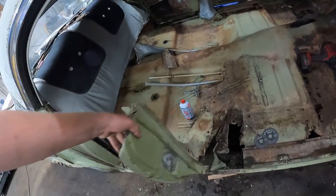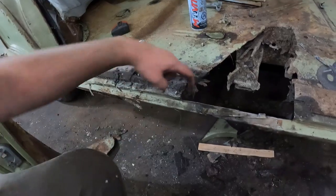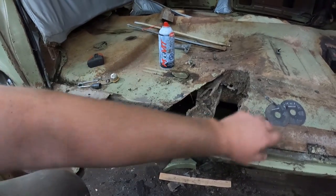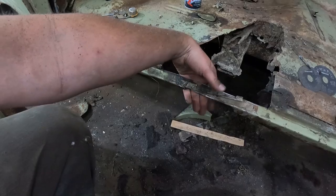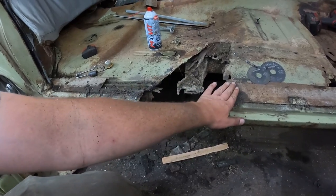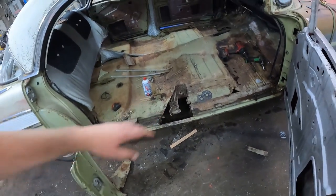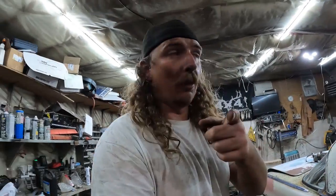This is a pretty hefty piece of goods. What I'm thinking: I'm going to run some of that thick steel under and weld that, then I'm going to get just some thin — I think I got 18-gauge or 19-gauge — and just literally put a piece over it and weld it in as an ugly patch. But then it'll have its strength back, because this is literally all that's in the rocker — there's nothing there, it's all rotted away. That's the plan: we'll have lots of strength across there. I might even weld something front to back on the side just to keep the shape as much as possible while we're getting everything set up.